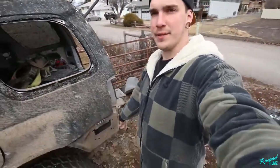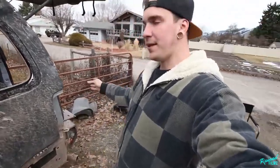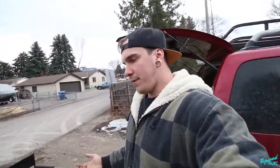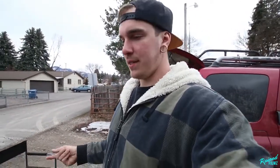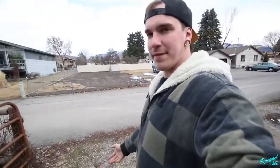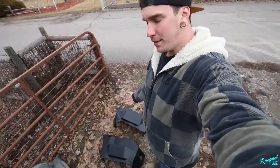And last night Travis and I took off the rear bumper caps. As you can see, they're missing. We pulled the taillights and all that stuff. And I proceeded to spend about 4 to 5 hours of getting the rust off of them and painting them. So we have them sitting down here. They have been fully sprayed, primered and sprayed with bed liner, and we'll see how well that holds up for now.